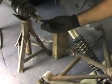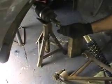Here's the drive shaft over here. This drive shaft will fit through the back of the hub carrier, through the hub, and the threaded end of the drive shaft will come out through here. Once it goes through, you'll put the washer on, put the castle nut on like so, and that will thread all the way in. Then you lock it in with this pin, which goes through here like so.